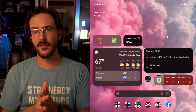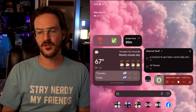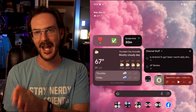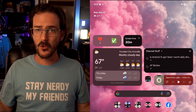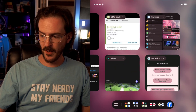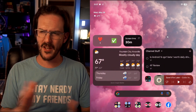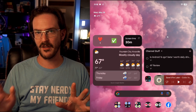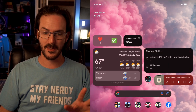I've also had times where the device got a little warm for no apparent reason. It's a Tensor processor so it does run a little warm anyway, but not overheating — just something happening in the background. While that was happening, my battery life went from being a normal all-day phone to dropping fairly noticeably. My fix was to open recents, scroll all the way over, and close all running apps, then reboot. That seemed to fix everything, but something was definitely hanging and causing the battery drain.